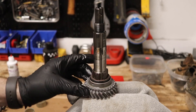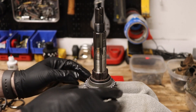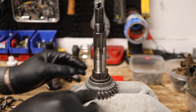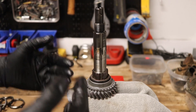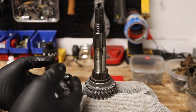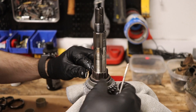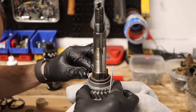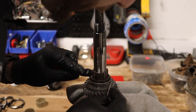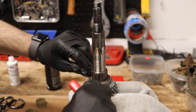This gear has holes on it that get lined up with that detent spring. What you do is lower this thrust washer down and push both of those detents in at the same time. I know it sounds impossible, but all you need are two little punches. Line this up and there we go.